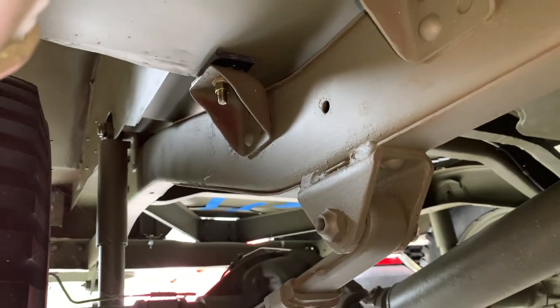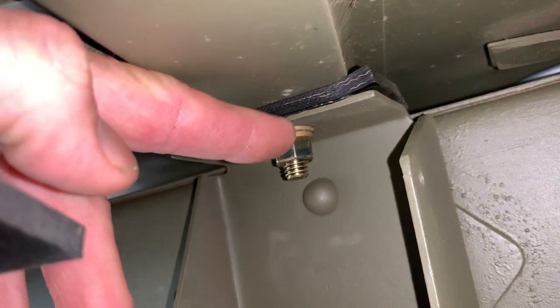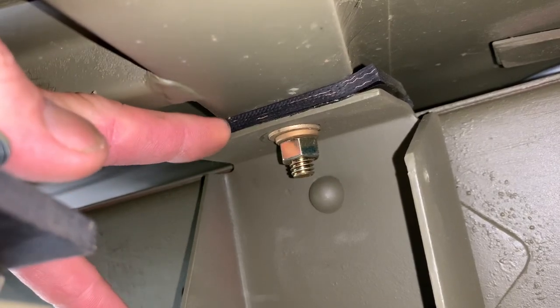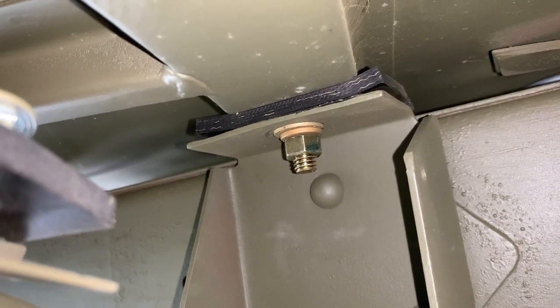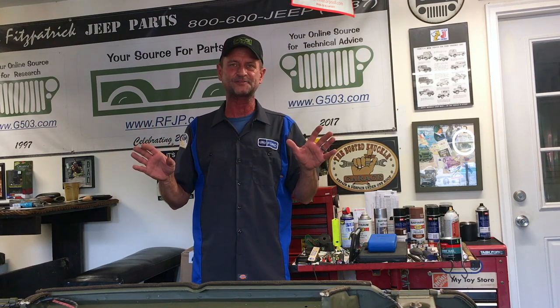One last thing I need to mention is when you're tightening these bolts, not only do you need to do it from front to back, but you also need to tighten them pretty tight. I couldn't find a specific torque spec, but how I did it was I tightened them just until that pad started to squish — you'll feel those bolts tighten up right about then. Try not to over-tighten them. I took a little Permatex Number 2 and blobbed it on those little rubber pads just to keep them in place. None of them fell out of spot, and I was able to adjust them a little more — so Permatex wasn't really a permanent deal. Just a little something I wanted to try, and it worked out good.